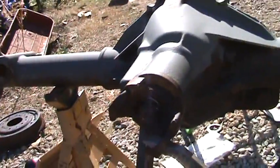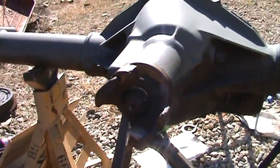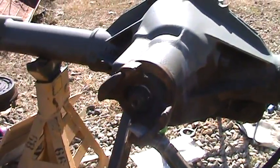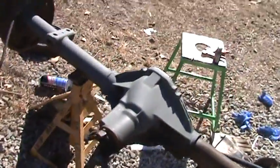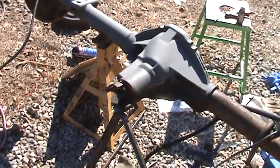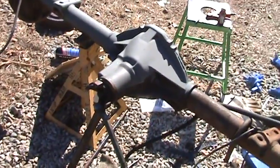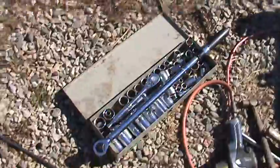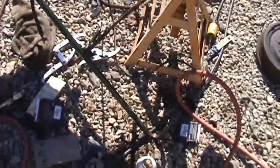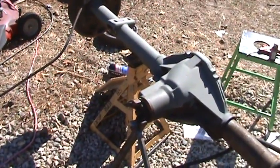We're back here on this pinion nut. I went in there and checked it out — it's about 300 foot-pounds of torque on that pinion nut. Some are saying change the crush sleeve every time you do that; I've never had to do it, but that don't mean nothing. You do this at your own risk. I brought my torque wrench out — it goes to 250 — I've locked that in with my pry bar. I've got 250, not quite 300, still have a little bit of slap in there.